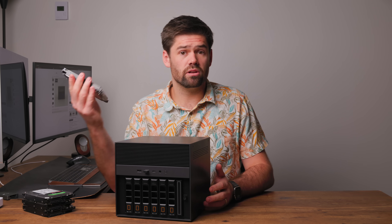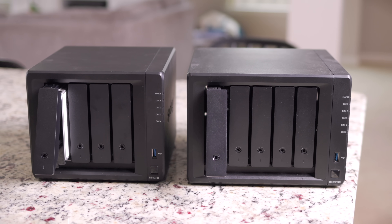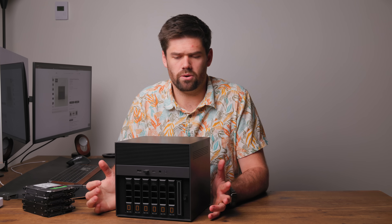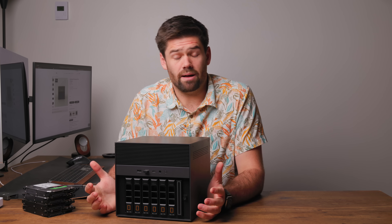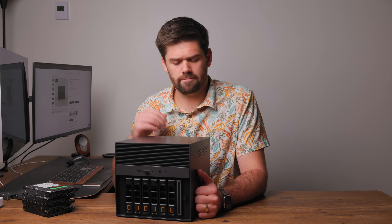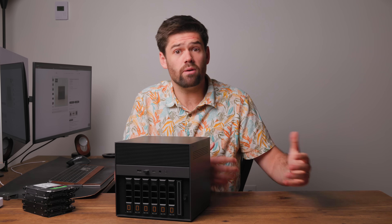The problem is when I installed these IronWolf hard drives, which I have used for years on different test benches, into the unit, it just would not boot. I turned it on and it wouldn't do anything — the light flashed for about three seconds and stopped. After debugging, I eventually realized that when the hard drives are plugged in, it's not booting. I finally figured that out, plugged them in anyway, and was able to test with TrueNAS. It worked great — I was really looking forward to using it as a TrueNAS test bench.